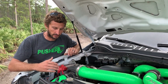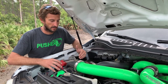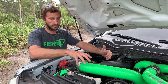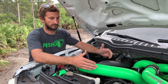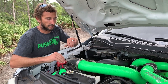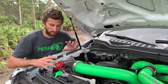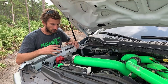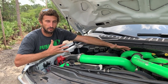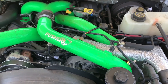Lastly for our major plumbing components is our cold air intake. By having this charger set outboard, we open up a ton of space in front of it, which allows us to have a nice large sweeping cold air. With the charger positioned inboard like other designs, you have the coolant bottle right in front of it, which really restricts a nice flowing cold air — that's why you see a lot of cobra-head boot-style setups on competing kits. Shops I've spoken with say those tend to rub and are tough to install. Over here we have a ton of room and run our standard air filter used in all our other kits, allowing for a super-efficient five-inch cold air intake. That wraps up our major plumbing components for the compound system.